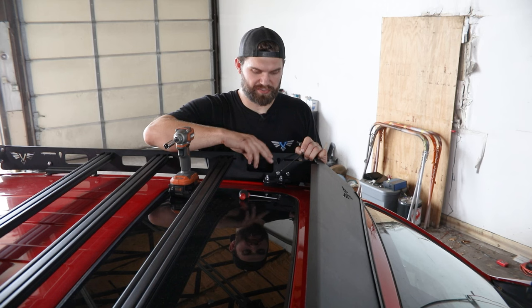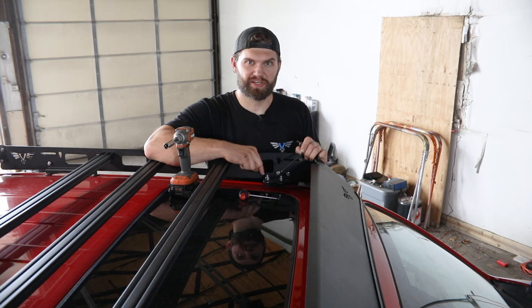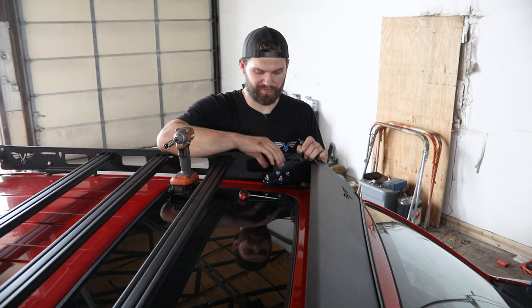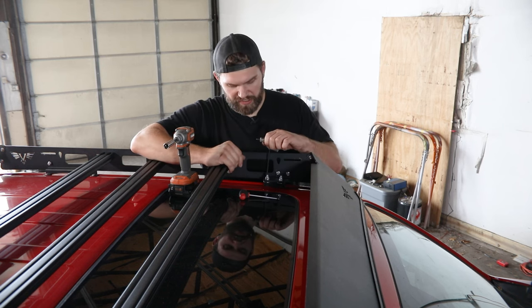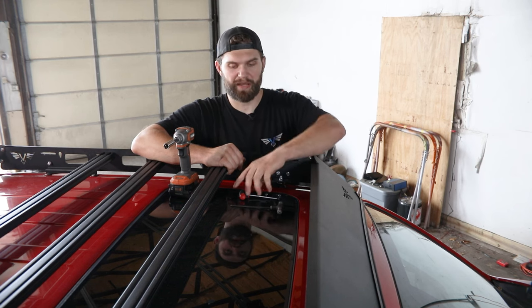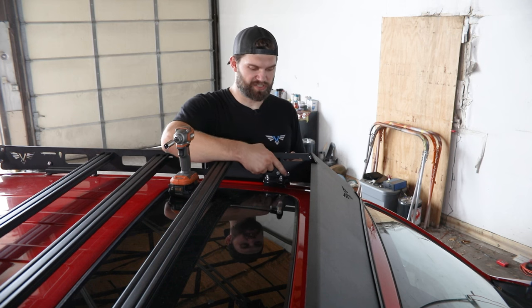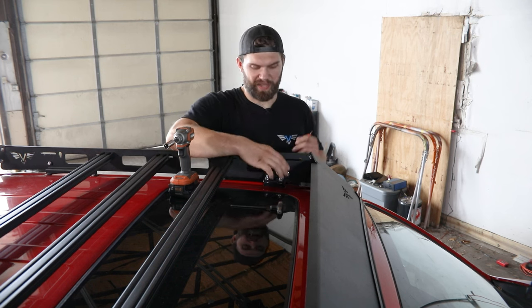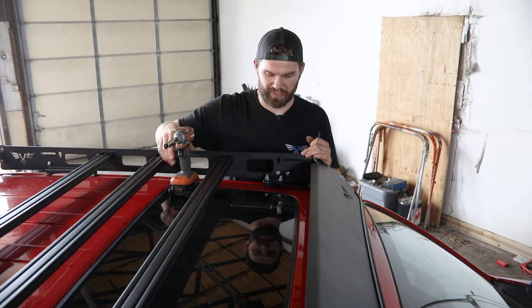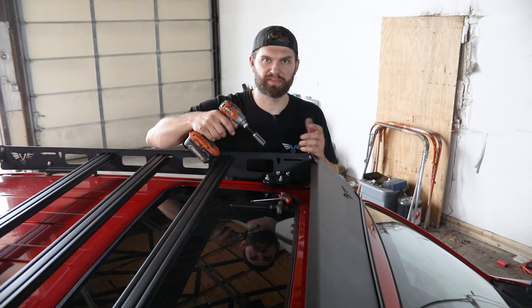On the front bracket, you will likely have to separate the two halves just temporarily. That's to be able to get the mounting hardware adequately installed as well as properly sealed. You can then reassemble them as you already had them before. Reaching down through the top, tighten that up with a four-millimeter hex. Then grab your 5/32" hex and tighten the outside mounting bracket to the side rail temporarily — that's just to pull this top half of the bracket out square to the side rail itself. Then take your half-inch socket and tighten your carriage-style bolts here for the final time.